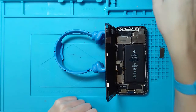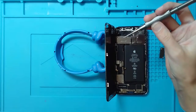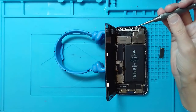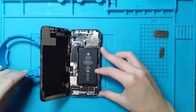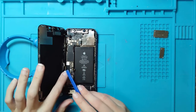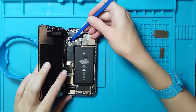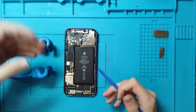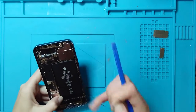Now that that is done, let's remove the screws up top — you should have four; I have two missing, so I only have two. Get those removed and set the bracket out of the way. I'm going to take the spudger and disconnect one cable, two cables, and then a third cable. Remove the screen and set it to the side, and set the housing over to the side as well.